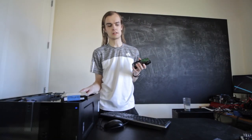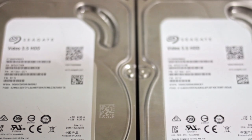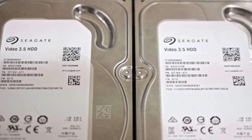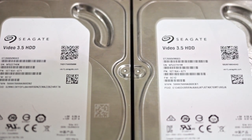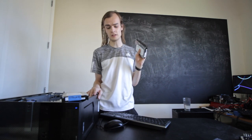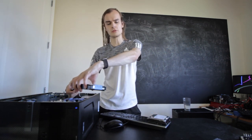One last set of drives to look at: these are Seagate video drives — ST2000VM003 — also made for home DVR systems. These are a bit interesting in that they'll only turn on and spin if plugged into a compatible computer. They work in pretty much every desktop I've tried, but won't work with HBAs, RAID controllers, or NAS boxes. Otherwise they're fine drives.